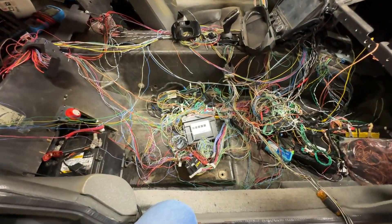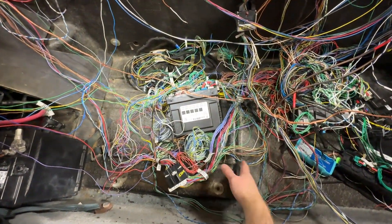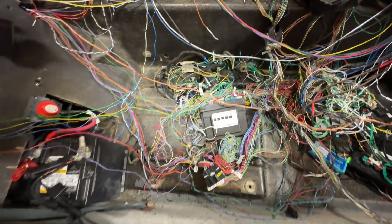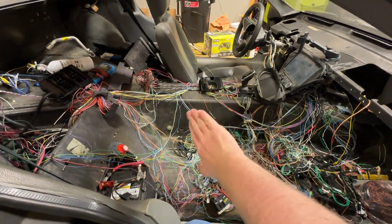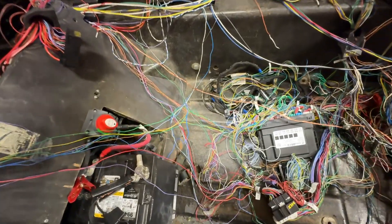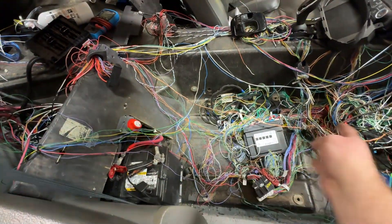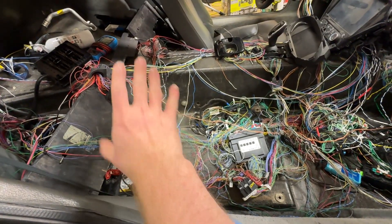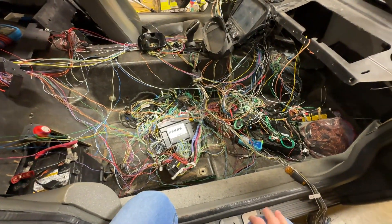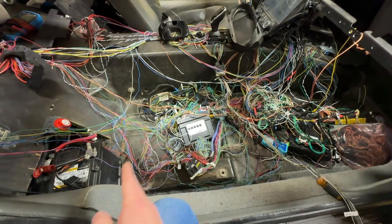I'm about 16 hours into this rewire job and it is looking so much better than before. You can see most of what you see here is the floor rather than just wires - there's just a lot removed. What I'm working on right now is making a separation between all of the stuff in the front of the car and all of the stuff in the rear. As you can see, there's really not that many wires remaining - maybe about 20 that are actually coming through into this area. All of these I'm going to cut and splice and get completely disconnected, and then everything on this side I'm basically just going to push under the dash and worry about that in the future.